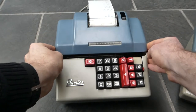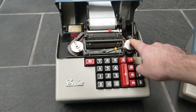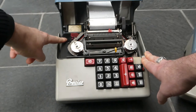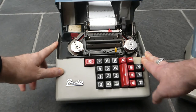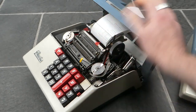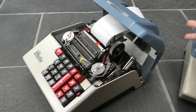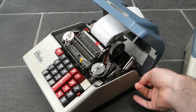If you lift up the top of the case it gives you access to the ink ribbon so it can easily be replaced. Over here is a jumper that allows you to select which voltage to use. The case is a really simple design — if you want to take it apart, you simply pull out this axle, this rod, and the lid comes off and the mechanism is released and can be taken out. So the whole case and mechanism is held together with just this one axle.